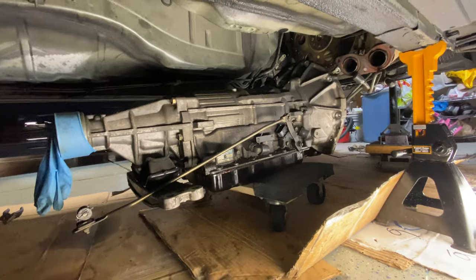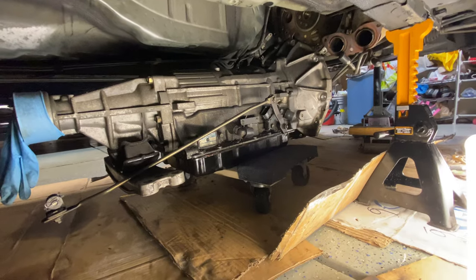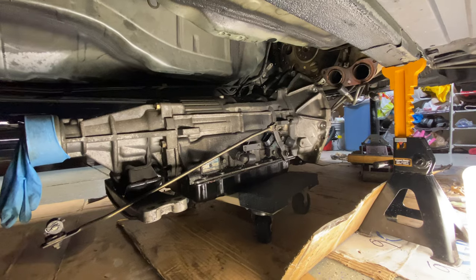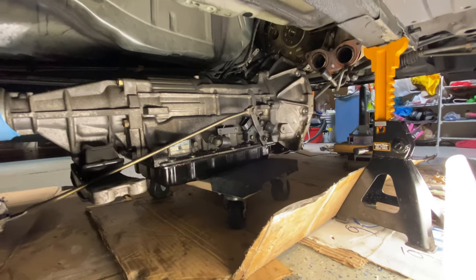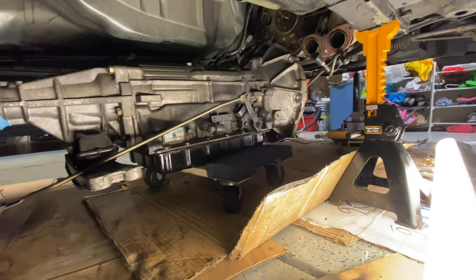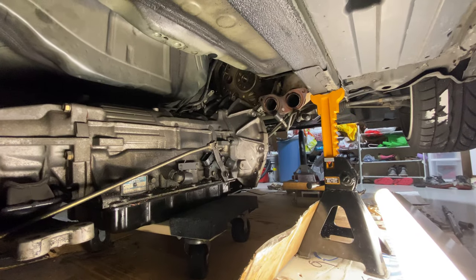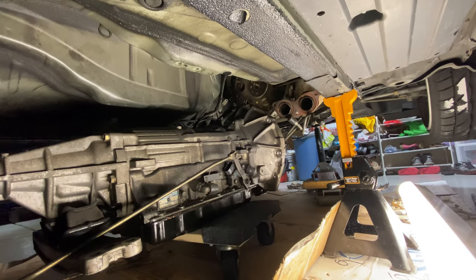Got this baby down — that was a lot of work but it eased down pretty well with the two-jack method. I've got a dolly down here. I don't have real clearance to take the bell housing out, but I think I can jack up the side a little higher to get it out off the side. I want to clean this up even though I'm only going to use it for maybe another year while I'm collecting parts for the manual swap. A couple of the brittle harness clips also broke, but that's no big deal. Now I can get out there and do the rear main seal, clean up the oil and grease, and put it all back together.